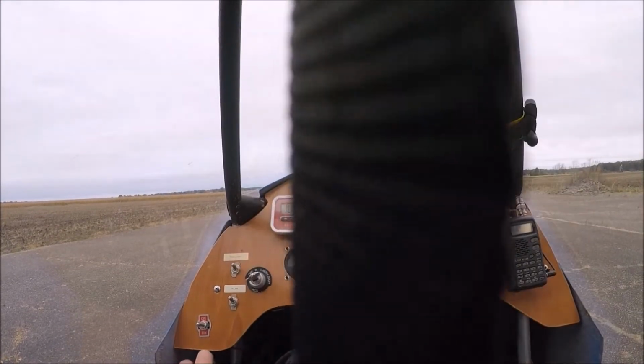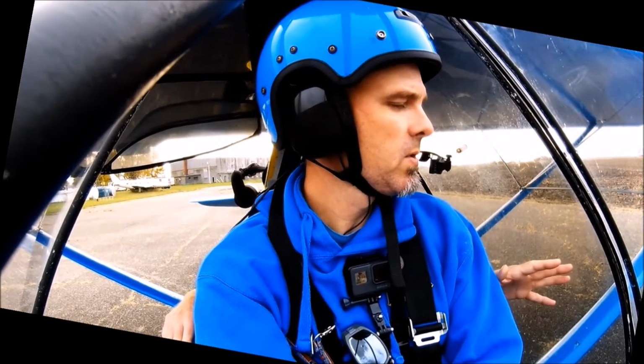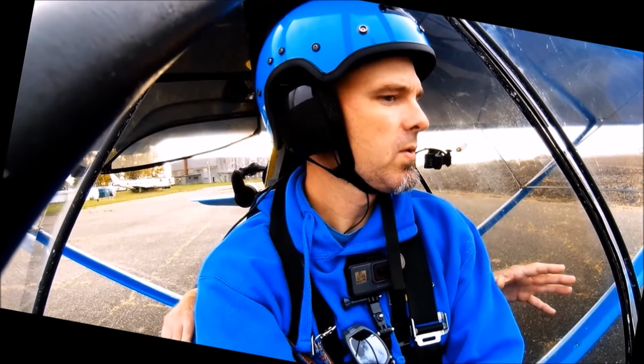See, that's 4,000 there. So left side. There's the drop. Back to both. Right side. There's the drop. Back to both. Okay, that's a good mag check. And then back to power back off. Yeah, all the way to idle. To idle, yeah. Because we want to be in sort of a landing configuration. Make sure it's going to continue running in the landing configuration, which is full idle.